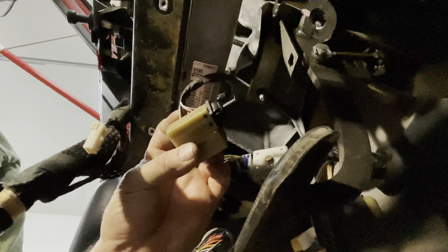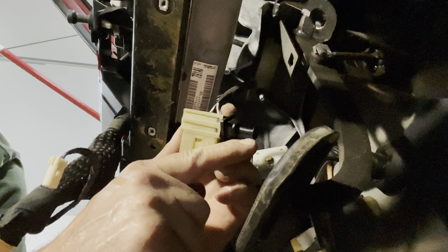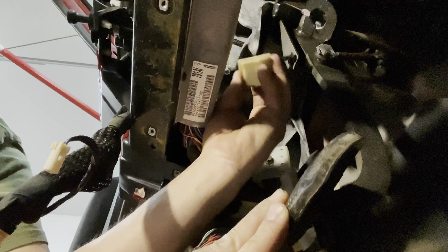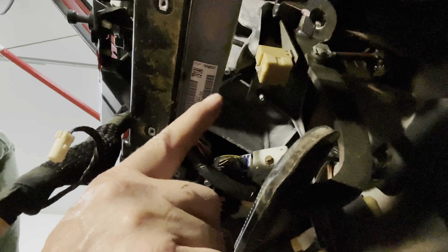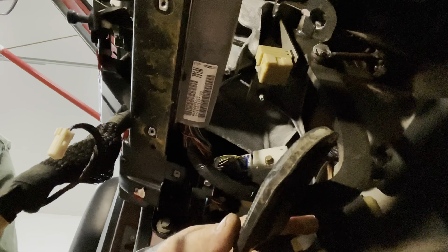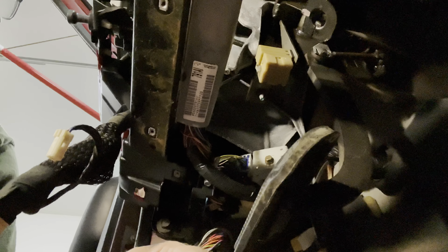Now we're ready to put the brake switch back in. What I do is normally readjust them while I've got them out. Take the plunger and you'll hear an audible click — that is pulling the plunger away from the body. Then I depress the brake pedal a little bit, put the switch back in there, twist it to lock it into place, and let the brake pedal fall back to resting position. You heard that click — give it a little more adjustment, pull the brake pedal back to where the plunger clicks back in. Now that brake pedal should be adjusted for that switch, and we'll verify that once we get everything put back together and the battery hooked back up.